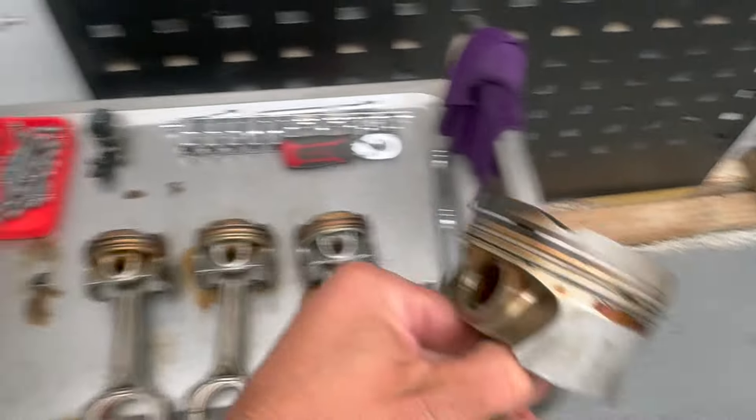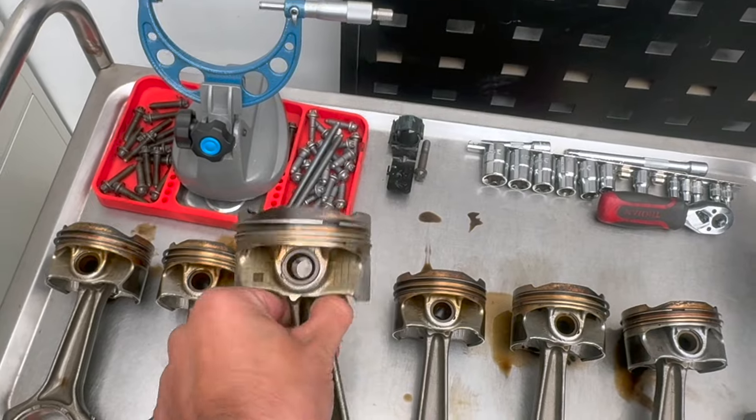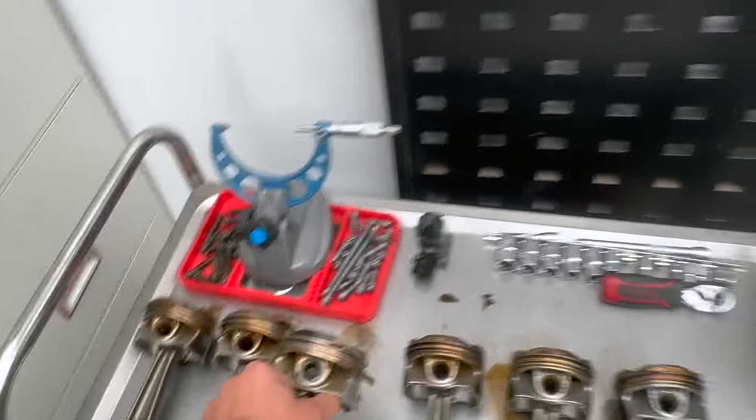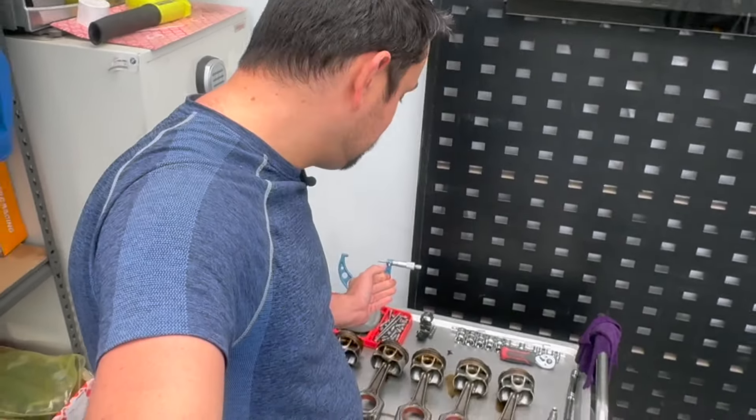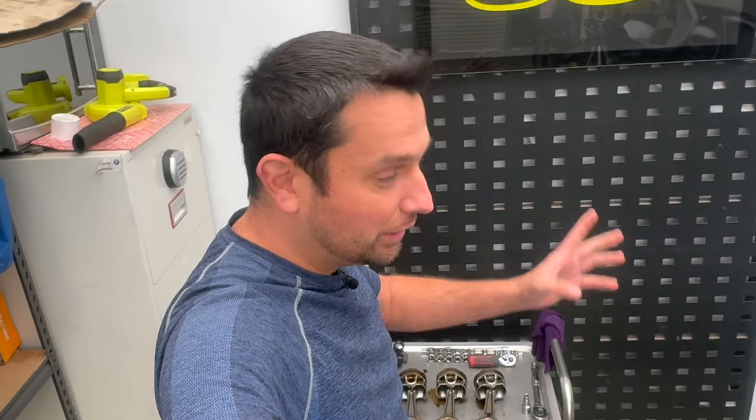Compared to the bore, this piston was about 0.2 millimeters of play inside the bore. So this piston was rocking inside the bore — this is what was causing the noise and obviously the wear. Now you'd think we could just drop in new pistons and new rods and it would be fine. That's what my friend the mechanic wanted to do. He said the engine is good, the cylinders look good, there's no scoring or scratching. So the plan was to drop new pistons and rods in without even removing the crankshaft — that's the reason the crankshaft is still in place. However, there is more to the story.